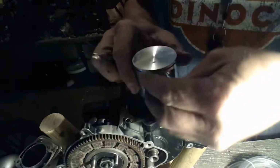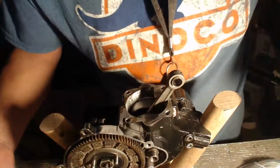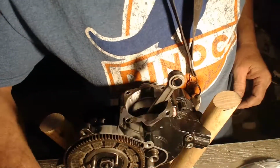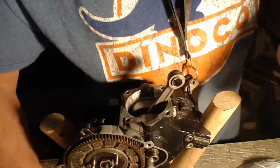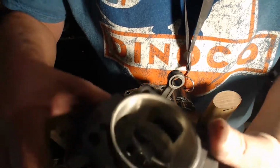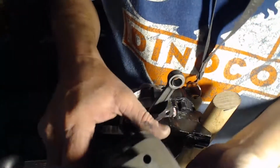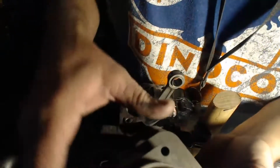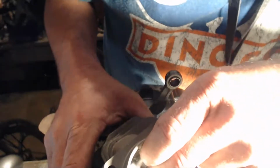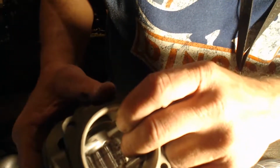Pull the ring out or clip out, and let's drop it in there, and then see how the piston is made to the cylinder. So I'm just going to drop it in. Okay, and then we're going to check. Transfers are completely open all the way. In between the intake at total drop, we are 4mm from the bottom of the skirt. Halfway up, the piston skirt just barely covers, so I can't take any of the side pistons off. It just barely covers both sides.